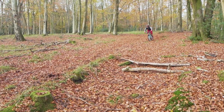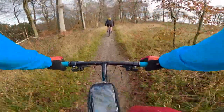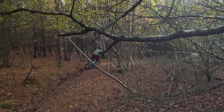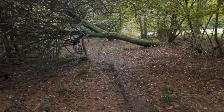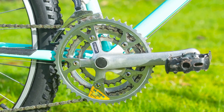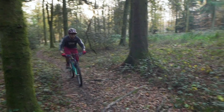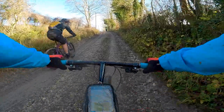While a dropper isn't overly necessary for a bike like this, I do still find that I use it quite a lot, because every millimetre of drop counts on the descents. I use the bike for more cross-country and gravel-oriented rides and less technical steep stuff, though that can be quite fun too. Those new plush tyres mean I can run them at slightly lower pressures, which makes them great for rooty fingery type trails. The old-style Shimano Biopace oval chainring was a bit hard to get on with at first, as the hardest part of the stroke happens when your feet are horizontal. After a few rides I kind of got used to it — it's a nice novel nod to the past and very in keeping with the character of the bike.